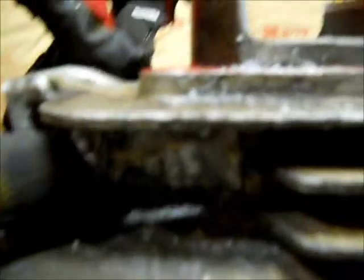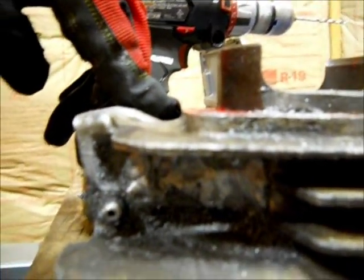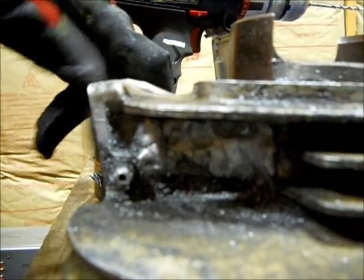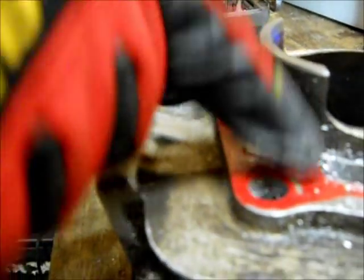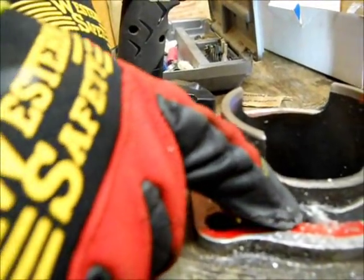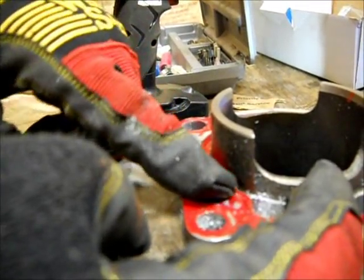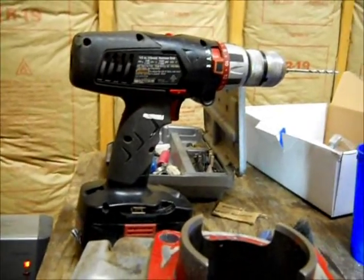Now, we went ahead and built these up, and the blasters are a little bit thicker as far as the base. But again, we built that up. We had one we blew through before. You'll notice that the length from the transfer to where the intake runner is longer because you get a narrower transfer. It's not nearly as wide right here as it is in the blaster. So, I mean, that adds a little bit of complication to it as well.